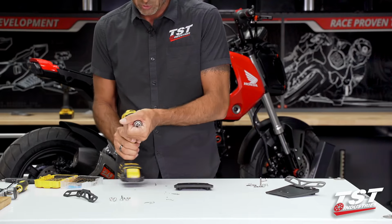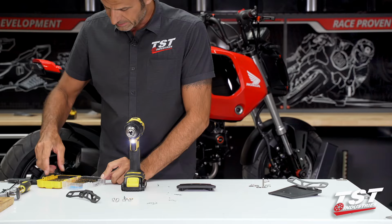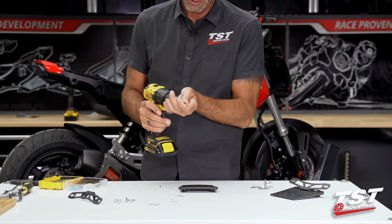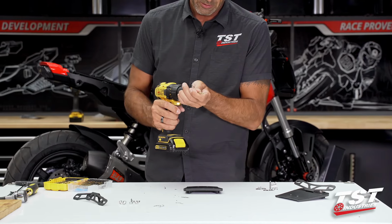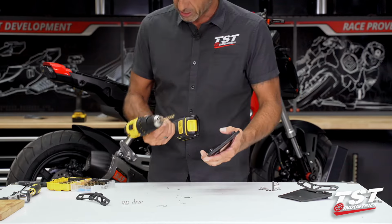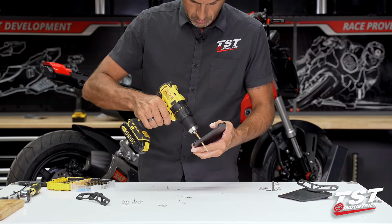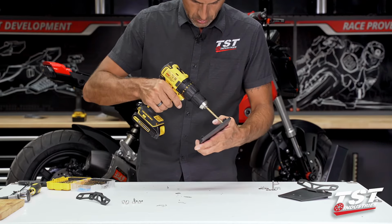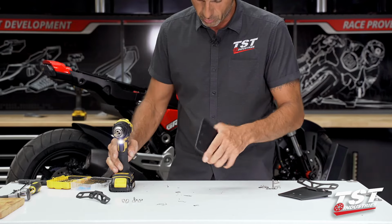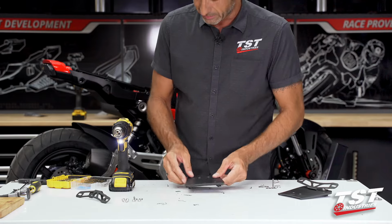We will once again switch to another drill size. We'll go to 15/64, which is very close to 6 millimeters. If you don't have a large selection of drill bits, 1/4 inch will work here too. And remember, with this largest drill, we're only drilling out the outside holes and not the middle.